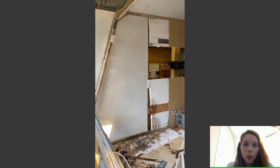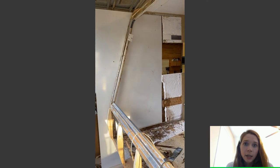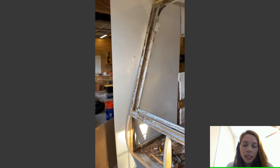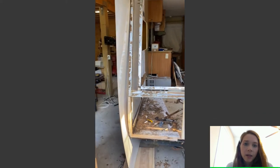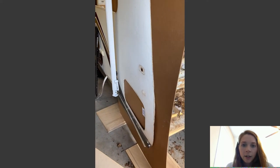So this camper actually had some really significant damage. The wood that was epoxied originally to the fiberglass shell was completely rotten. So what I did was I took the fiberglass off, scraped it away as much as I could, and went from there. So obviously we will start with taking off all the trim, all that stuff. Basically everything that I said in the front delamination video, you're going to start with that.